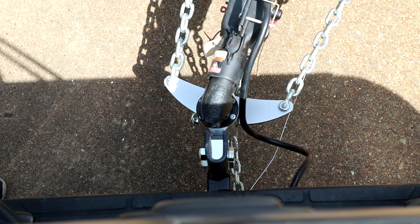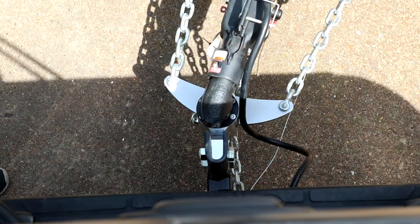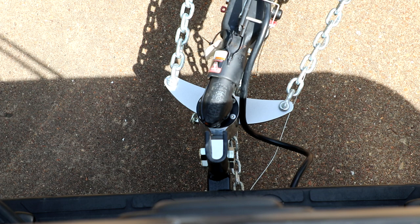Sometimes when backing into a campsite you may find that in order to get the trailer straight the truck itself may be at a slight angle. This is okay — the triangle plate, chains, and everything will still be nice and straight with the camper itself, but the ball housing and ball mount with the truck will be at a slight angle. This does not change the way you disconnect the Anderson; however, in a moment we'll look at how it might affect reconnecting. But at this point, the disconnect method remains the same.